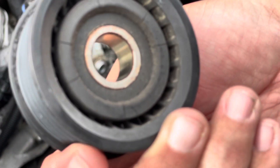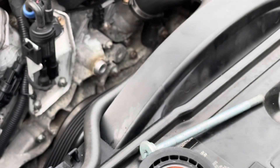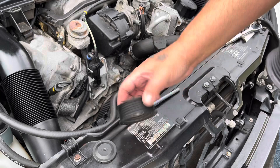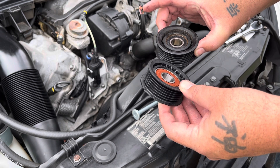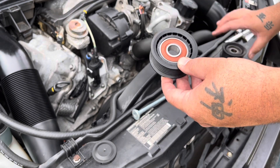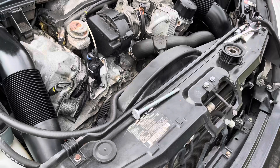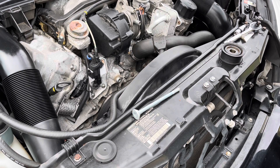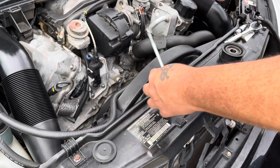It's really cracked too — see how cracked that is? I would have never known unless inspecting it. Cracks in the pulley will also let you know it's going bad, along with the grease. Comparing the old one to the new one — I'm not sure what's the front or the back — but this new one is actually made in Canada, so that's even better. Let's go ahead and put this on.